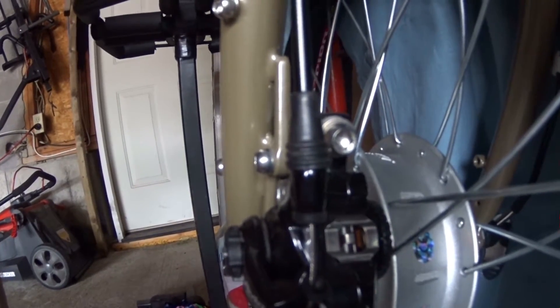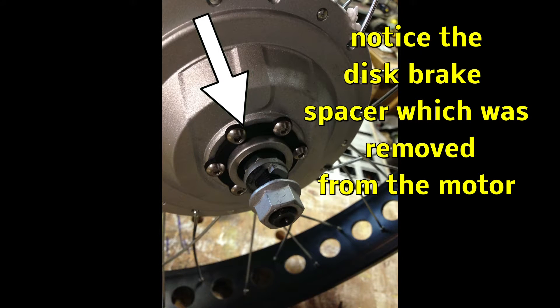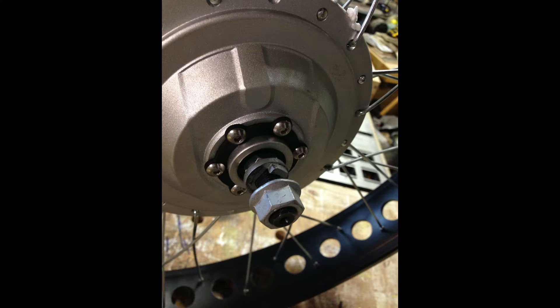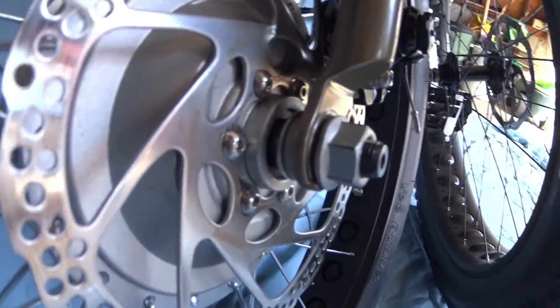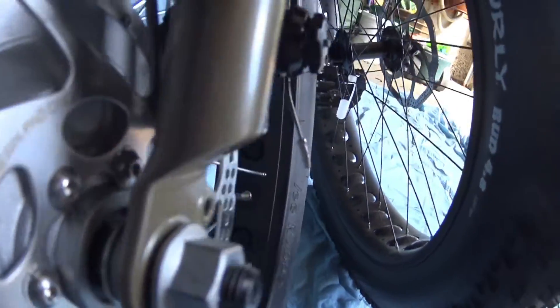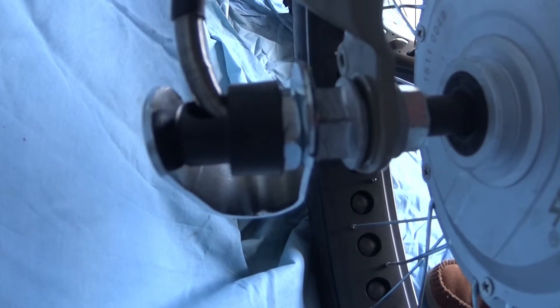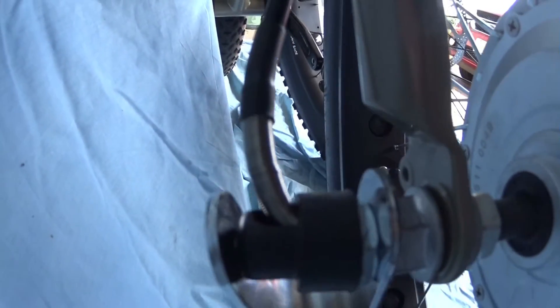The steel forks are much stronger and can hold the torque of the motor — you can imagine that little shaft is turning the whole wheel. The parallel sides on the shaft plus a little square part on the inner washer hold the torque of the motor in the front wheel when you give it power. Another thing the steel shaft does is right at the bottom of the dropout section there's a little weld bead which makes it a little bit thicker, so this washer once tightened cannot twist or torque, and it cannot drop out because of that welded bead at the bottom.